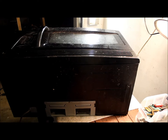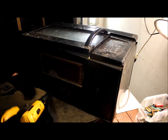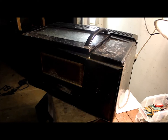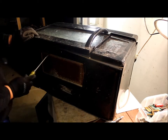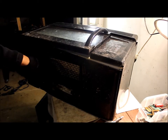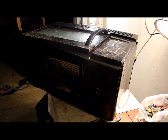On the bottom there's going to be some light bulbs, and sometimes they have a little electric motor for the plate — where the plate spins. We're going to take this filter off; the little motor is going to be in here. Once I take this case off I should be able to get that little motor out, so I'm going to unscrew all the screws and take the case off.